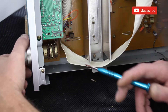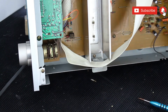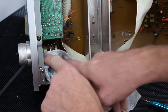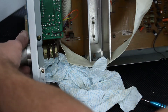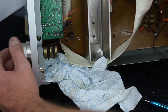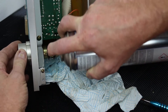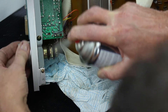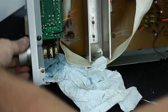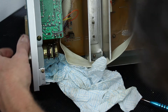Let's come down to the potentiometers here for the balance and for the volume. What I'm going to do is basically a flush through - put a bit of tissue underneath it and spray directly into those contacts whilst moving them around, and hopefully flush out any of the contamination in there. I'm just going to make it travel the whole distance and hopefully all the contamination was carried away by the first few sprays.